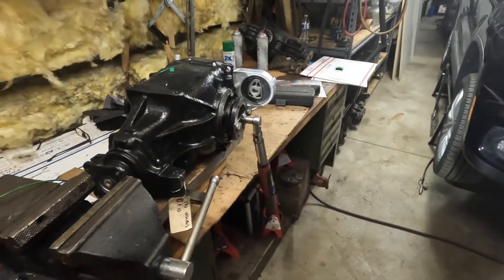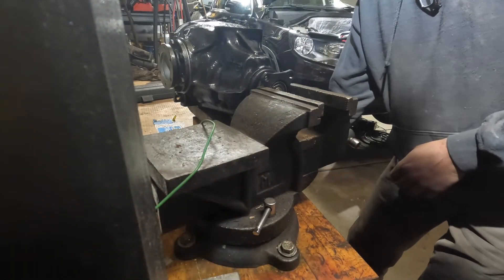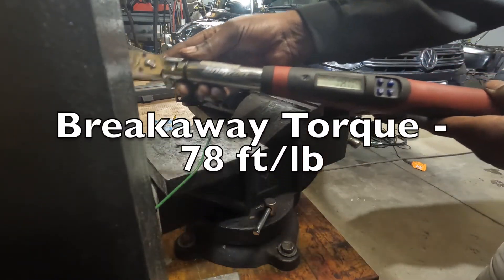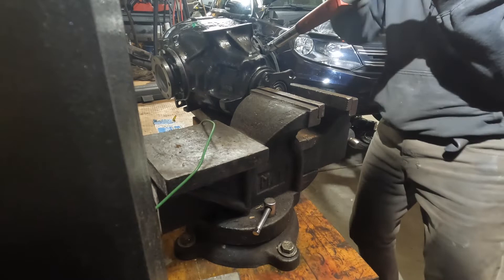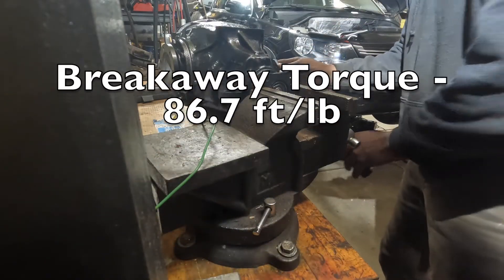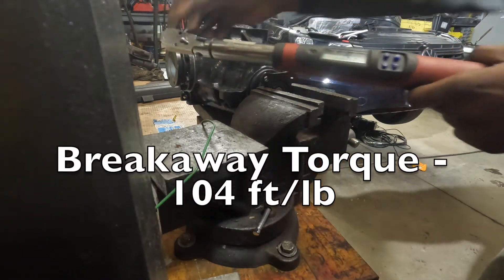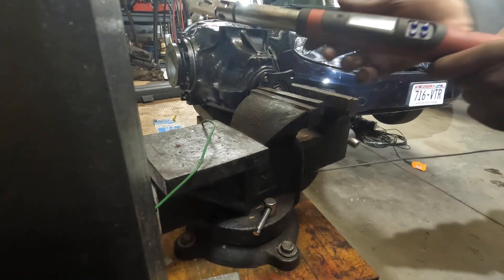Let's go ahead and see if we can get some rotational speed and see what the maximum value we get is. 78... 86.7... 104.7 — the faster you go, it's going to keep locking up. This rebuild is very good, the viscous is good, so there you go.